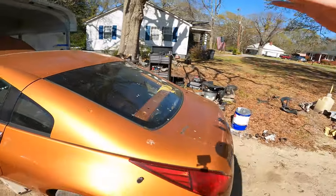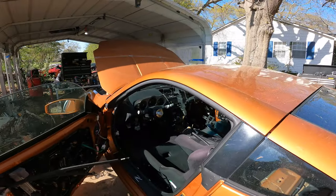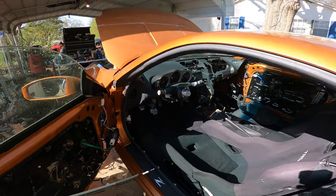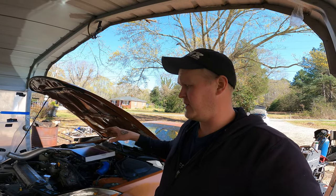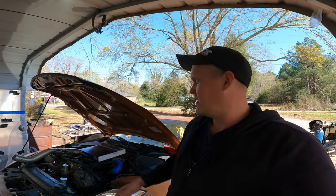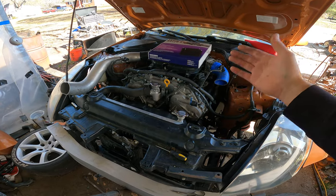I painted it and everything while it was all apart. This other car is a 2006 that I HR swapped pretty similarly - I used the interior and wiring harness from a 2007 350Z, but some stuff I left in like the door harness for this car, so I don't have the little light for the cup holders. The back harness is still the original for this car but the real mixed stuff is under the hood. I did the oil gallery gasket and water pump before putting the engine in.